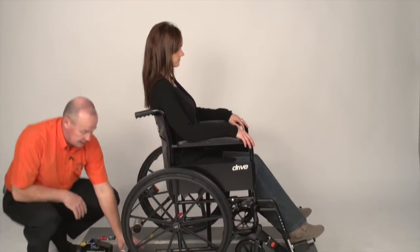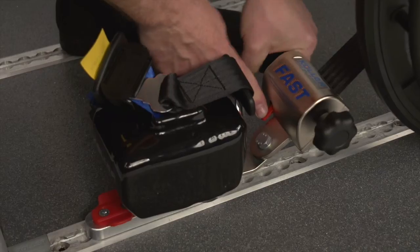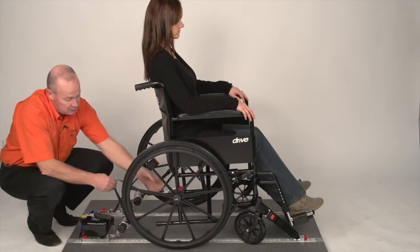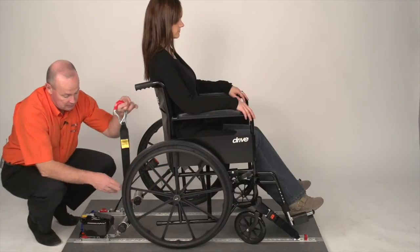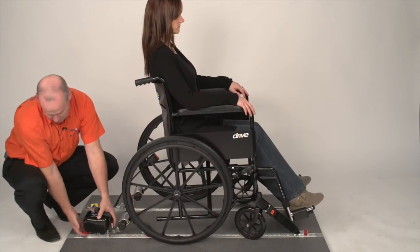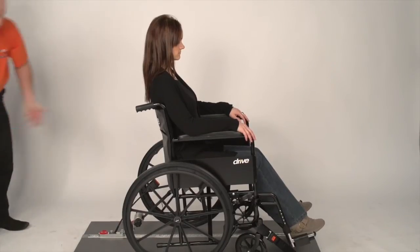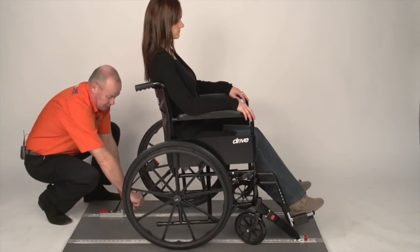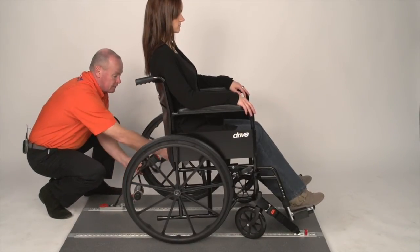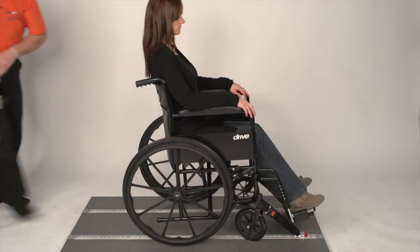To remove the FAST system, take hold of the winding handle, slightly turn it towards the passenger, press the red button down, pull the webbing out of the reel, remove the carabiner, let it retract in, and remove the clip from the rail. Same for the other side — turn slightly to release the tension, press the lever, remove the carabiner and it's free.